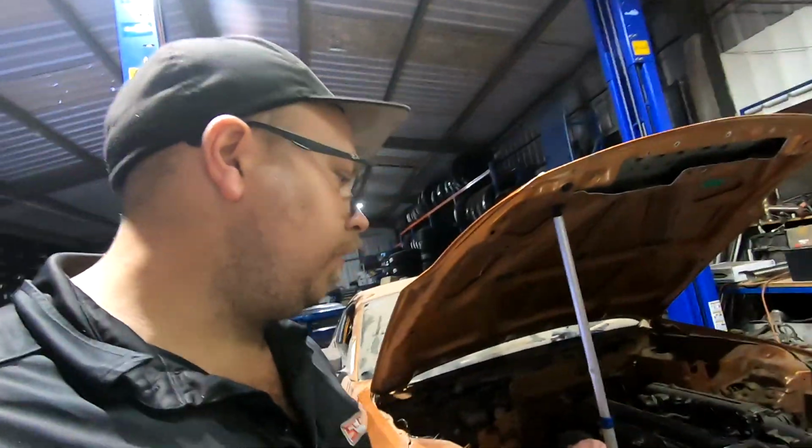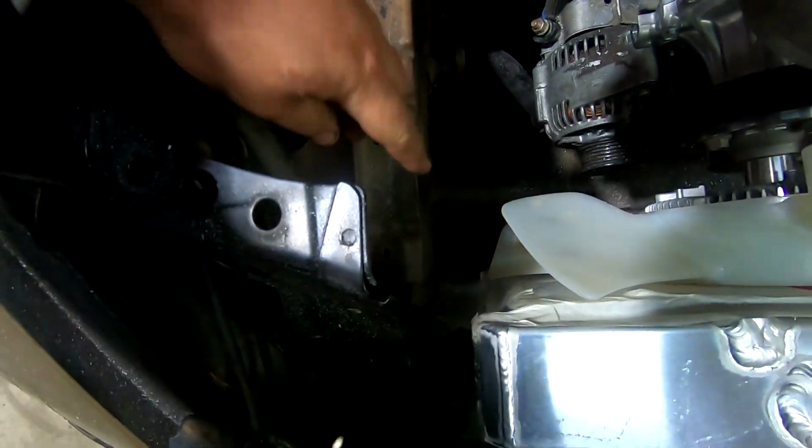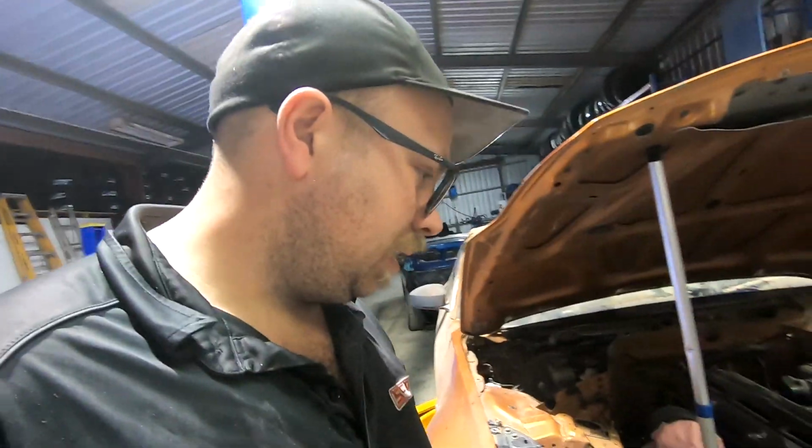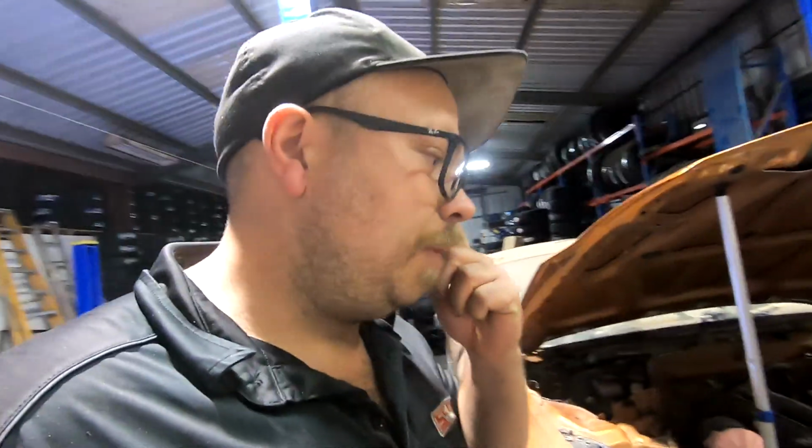The 350Z or V35 one or whatever, I'm pretty sure the outlets are wrong, that's why I didn't go with that one. I probably could have got a little bit wider radiator because there's a fair bit of room between the chassis rails here. There's a bit of a gap here and a bit of a gap over here, but I do still need to get some intercooler piping through there, and these headlights are chunky, so there's probably just enough room to get a cooler pipe through both sides with the headlights still there. So I think the SR radiator was a good idea.